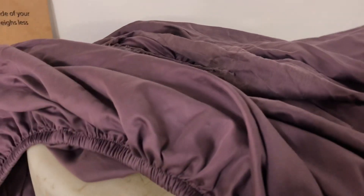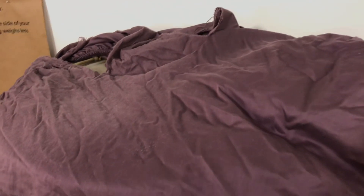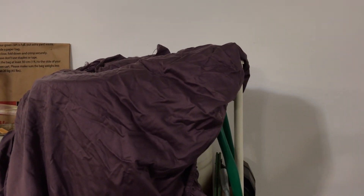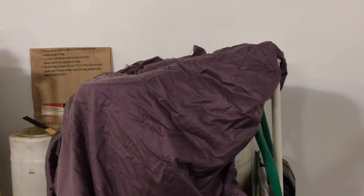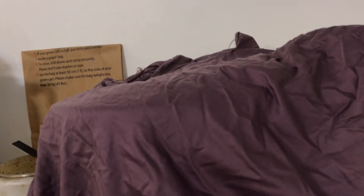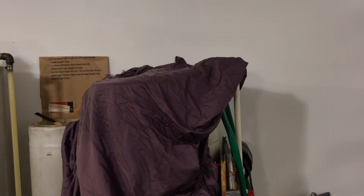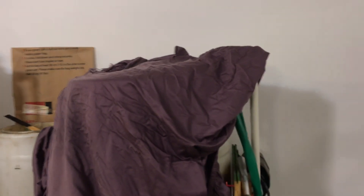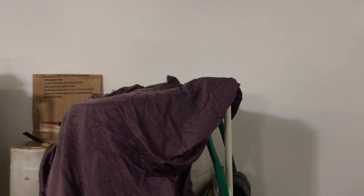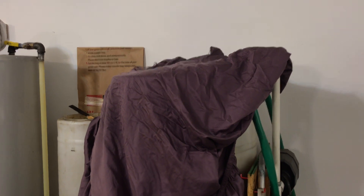I have an old bed sheet here to put over top — there's a hole in it over here for the air. If you don't do that, the vapor coming out is a little bit oily and you'll find an oily mist settling on your vehicles and floor. The sheet captures the oil droplets while still allowing the air to come through. Over time the sheet gets oily and I throw it away and get a new one. I do this for about two hours with the garage door open — I don't want methanol vapors floating around. Lots of ventilation, and that will evaporate the methanol and allow more impurities to settle out.